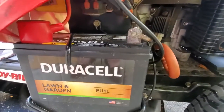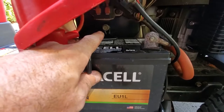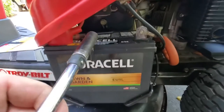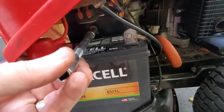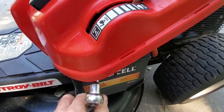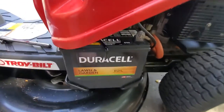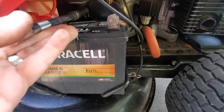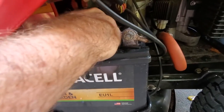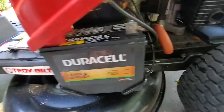If you look at the bracket, the battery here — this is your retaining bracket and it's held on by that bolt there, which is a half-inch. So get yourself a half-inch socket and an extension so you can reach in there, and the first step is going to be to remove that retaining bracket. I've changed my battery twice since I've owned this mower, and I just did it recently. I found that the batteries last about two years.